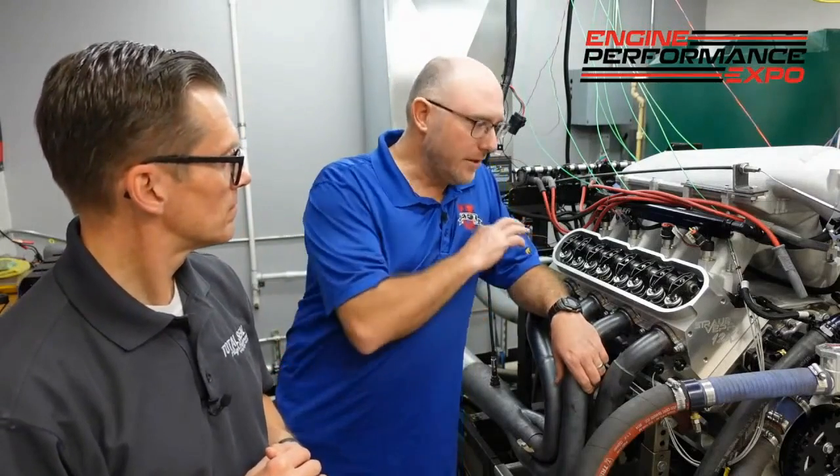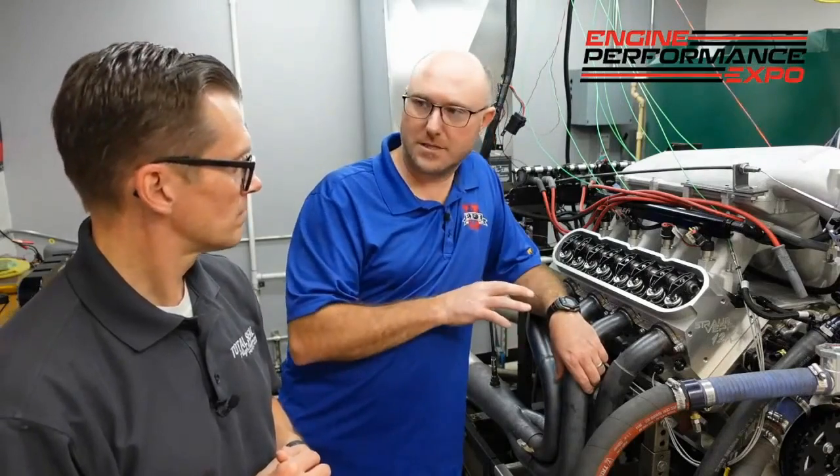Let's talk about pros and cons. What I like about the system is that it fits right on the cylinder head with no modifications — it all fits like stock, LS type locations. I love that it joins all the rockers together and adds a bunch of rigidity and stiffness to the system.